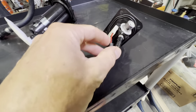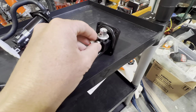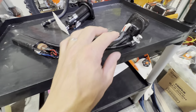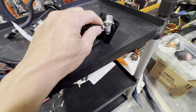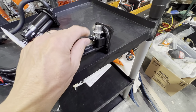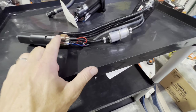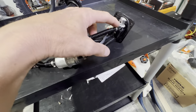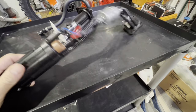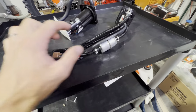We've also seen wire connector issues up here. On this exact one in front of us, the regulator has failed — it's stuck in the open position, so this bike has low fuel pressure and this needs to be replaced. This is all serviceable and rebuildable. The pump motor itself is replaceable, along with the filter and the regulator. You can buy all of these as individual components à la carte and rebuild this. We rebuild these all the time and sell all these individual components.